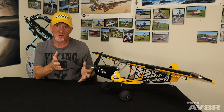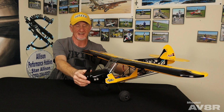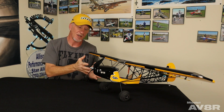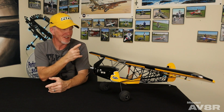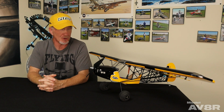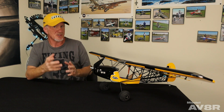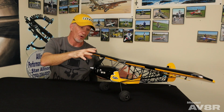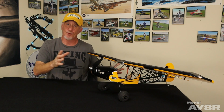It's past that pivot point now where the gear was, where when you get the airplane level, it actually wants to go over on the nose more than it wants to bring the tail down. And when the gear's in a position like that and that tail is that light, you have nose over troubles and you have a hard time keeping control of the tail, especially on a smooth surface, because it's just always so light. The other thing we did is we changed the angle of attack to give us more of a mechanical advantage and make it harder for the airplane to basically pivot over, to give it further to go.